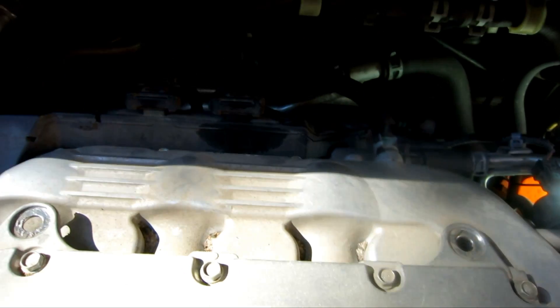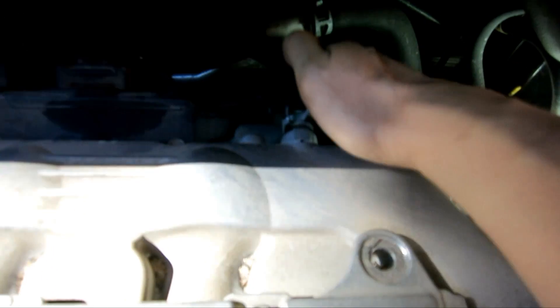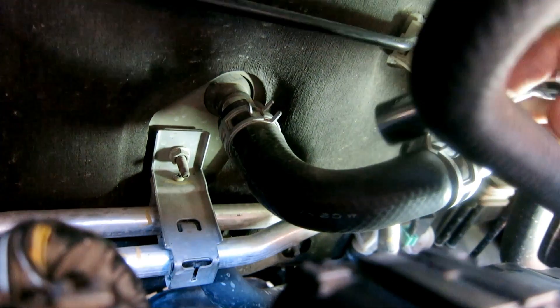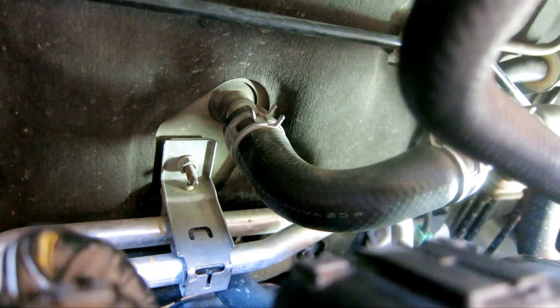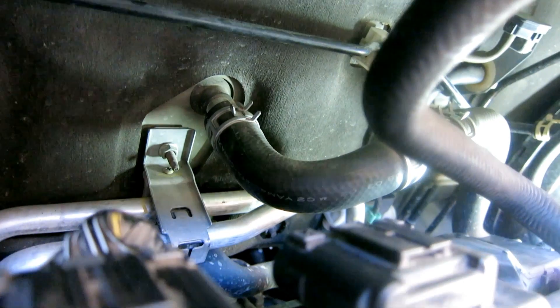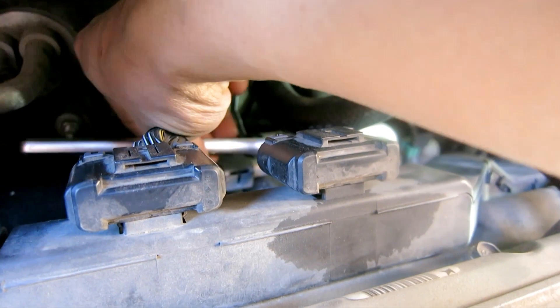After that's done, put it all back together. Now just plug the connector back in — that's it. Go through all six of them. The last spark plug that was hardest for me to replace was the last one right here. Using a swivel definitely works. You'll want to go through this hose cavity right here, put down the socket, and you want your wrench to be facing this way — right over here.